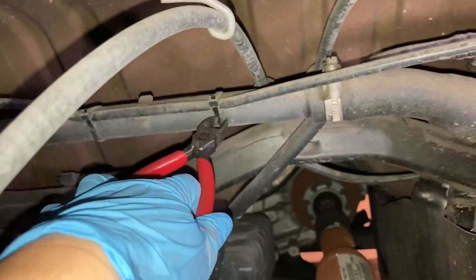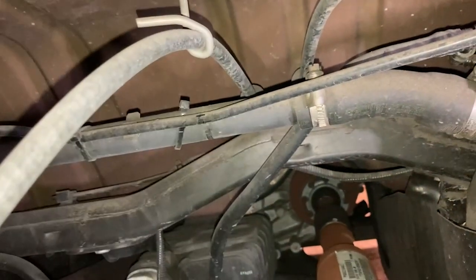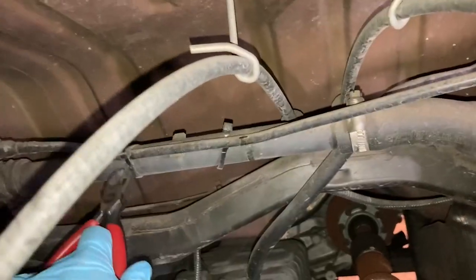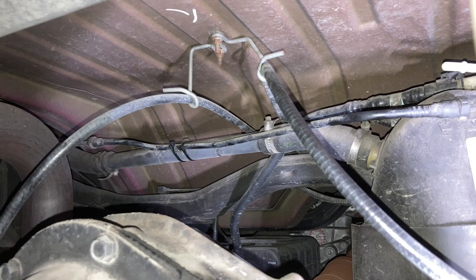We're going to make some extra room for this line and cut these zip ties and replace them so that this doesn't put more pressure on this poor little line. I just pulled the line toward the fuel tank as much as I could to give it a tiny bit of extra slack and secured it with two new zip ties. Plug the line back in, and you can either turn the check engine light off or wait to see if it'll go off to make sure you don't have any other EVAP leaks.